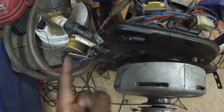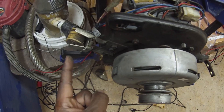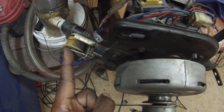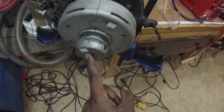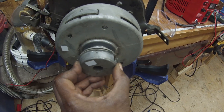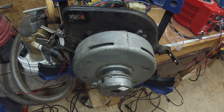The first thing we've got to do is figure out how to actuate this. I know I need to run current through it, but should it be DC or AC? We're going to figure that out — what kind of voltage we need and whether we need AC or DC. Then we're going to check the speeds, which is why I put this reflective tape. This one is directly connected to the shaft and this one is on the clutch. Let's do some experiments.